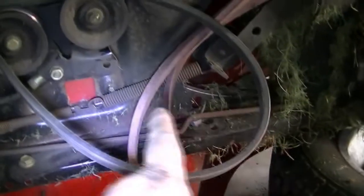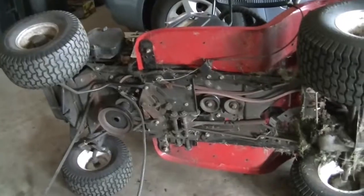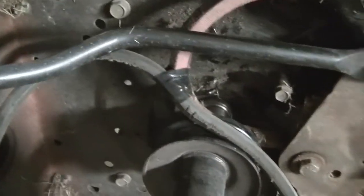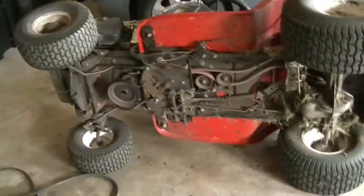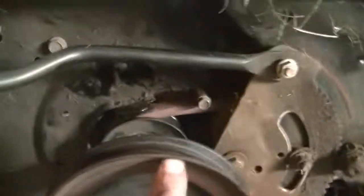Now I will start working my way up. I will attach both the belts through the tape and start pulling them on the other side. The new belt did pass through easily, nothing in between, no hurdle, and it came out on the other side. So I had to slide this out completely, put the new belt on the small pulley and push it in.